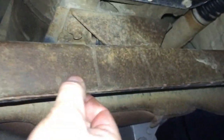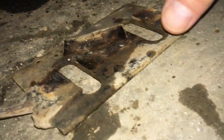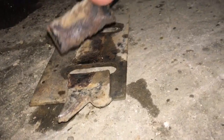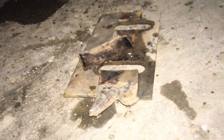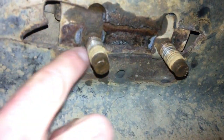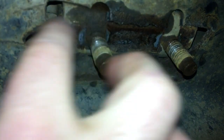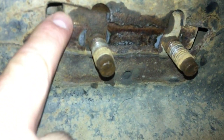Now, the metal support — where are the transmission bolts to this thing? There's a little chair here. I'm assuming that's some sort of rubber isolator. Yeah, I can see the rubber inside there. Okay, this is the plate that came off the bottom. There are pieces of the crossmember that are torn off or vibrated off or worn off. And when I look at the hole underneath here, it's all tore out here. There should just be a slotted hole here and a slotted hole here.